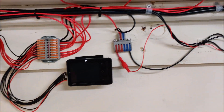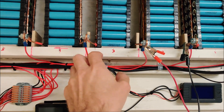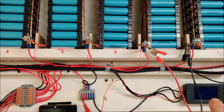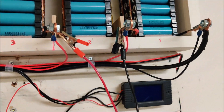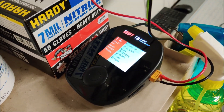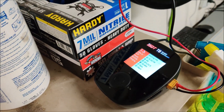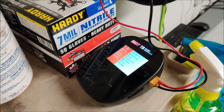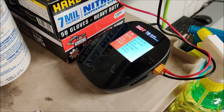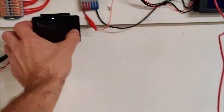This is the same way a balancer works: a balancer pulls voltage individually from each pack using the balance wires and can address just an individual pack. So we can effectively do the reverse and throw a little voltage at it. I have my ISDT hooked up throwing 1.4 amps at this pack. These are big packs — 80 cells — so one and a half amps is barely making a scratch. It'll probably take at least 30 minutes.